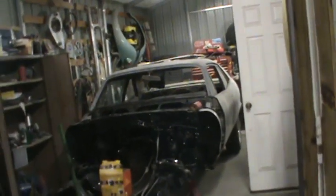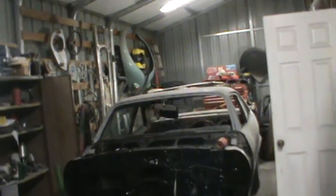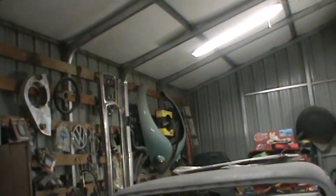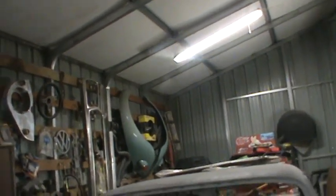I need to get some bolts cleaned up — still out there in the parts washer. I need to start making an hour a day on this car, but I just haven't had an hour in a day lately. I'm gonna try to pull these fenders down today and get those holes welded up while I'm welding that last little bit on that fender over there. Once I get these fenders done I think we'll be ready to get some paint going.